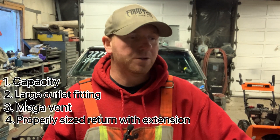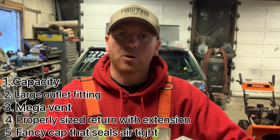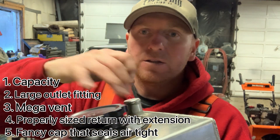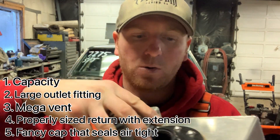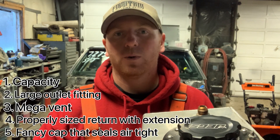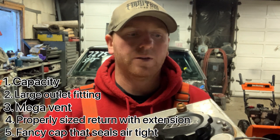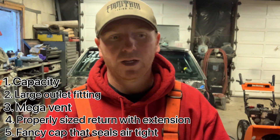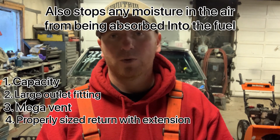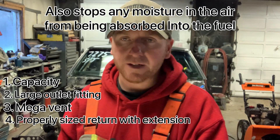The fifth thing you're going to want to do with the fuel cell is get a really good cap with an O-ring seal on it. Usually the threaded ones are the best so that you can seal it up — it's got the O-ring on there. A lot of guys will fill the cell right to the top when they're not using it and plug the vent, so there's no air in there to allow any corrosion to take place. Lots of guys will just leave it like that and don't have any problems. Good cap goes a long way.